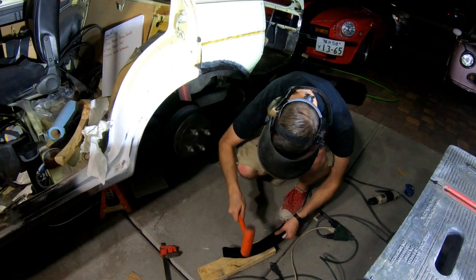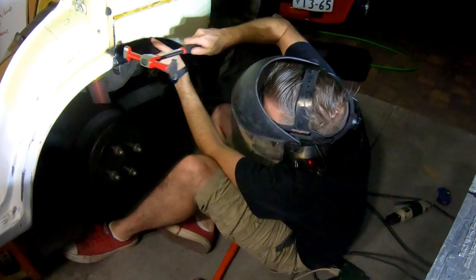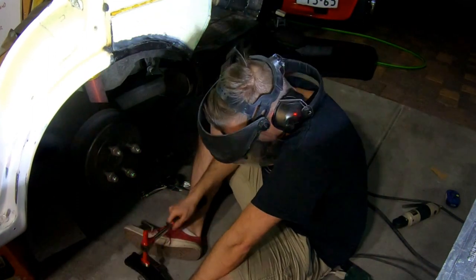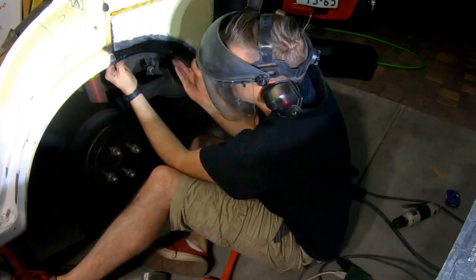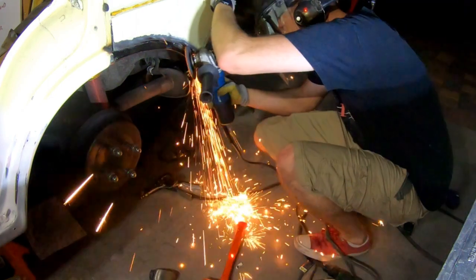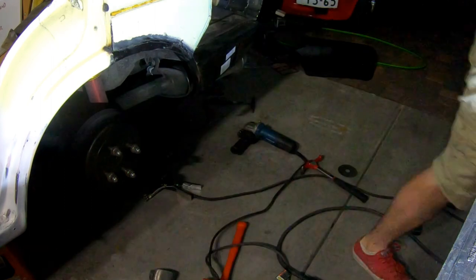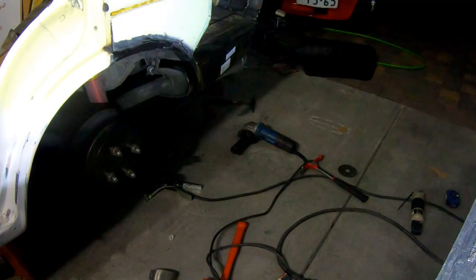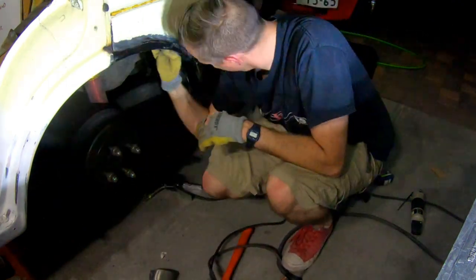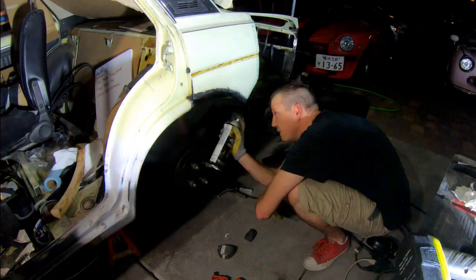Once it's welded in, I start doing the final fit of the rear quarter just to make sure it's fitting closely. I then took the portion of the outer arch that I didn't use, cut it out, and added it as the new arch — I think it turned out pretty well, but definitely not perfect. Once I got the arch in place using just four spot welds, I did the last bit of trimming on the old quarter to ensure that it wouldn't require me to make up a large amount of distance. Although, in the next video you'll see that I didn't quite do it very well and did have to end up making up quite a bit of distance with my welds.